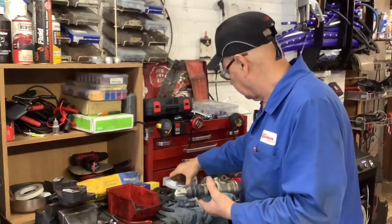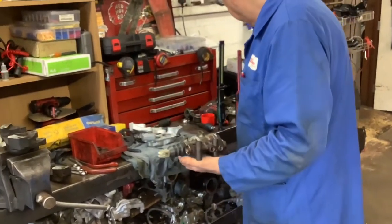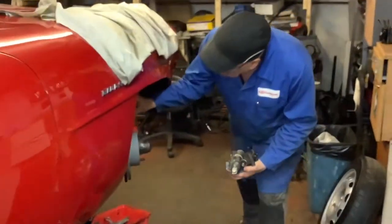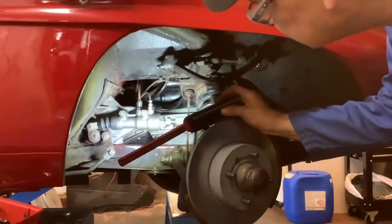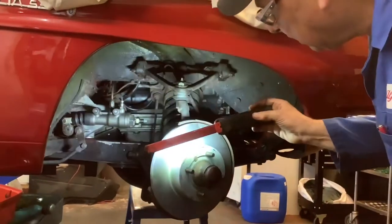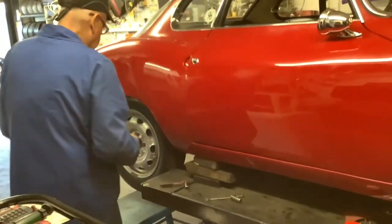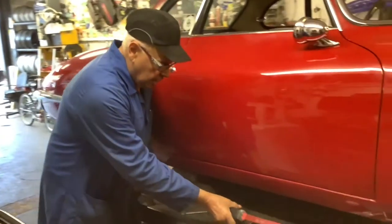The other thing I've done is I've changed the brake master cylinder that was leaking — I'll just show you where it's situated. That's the new one installed and ready to work pretty soon, once I've assembled the rest of the stuff up. The customer supplied me with two new discs and a set of brake pads for the front. On the rears they were all fine — all I did was adjust the rear shoes up and now the handbrake works properly.